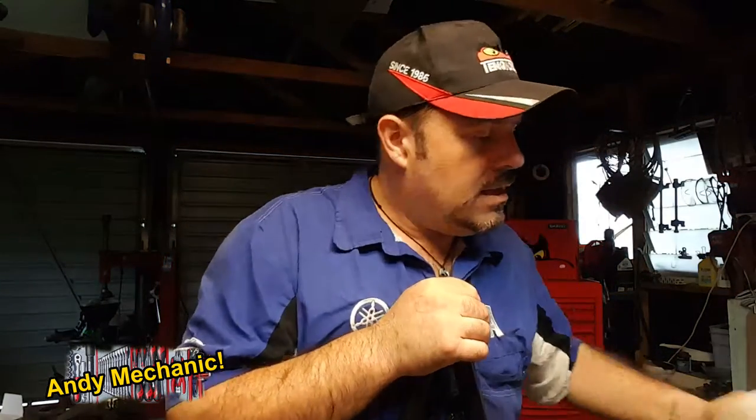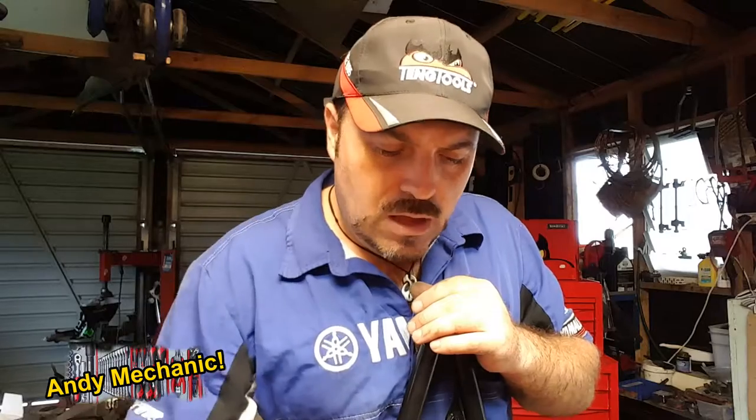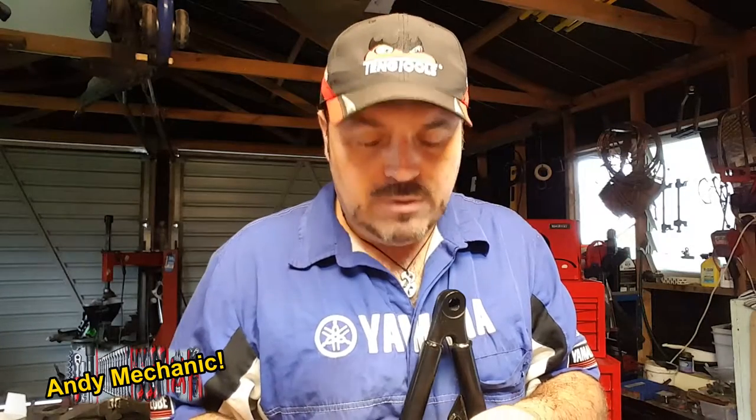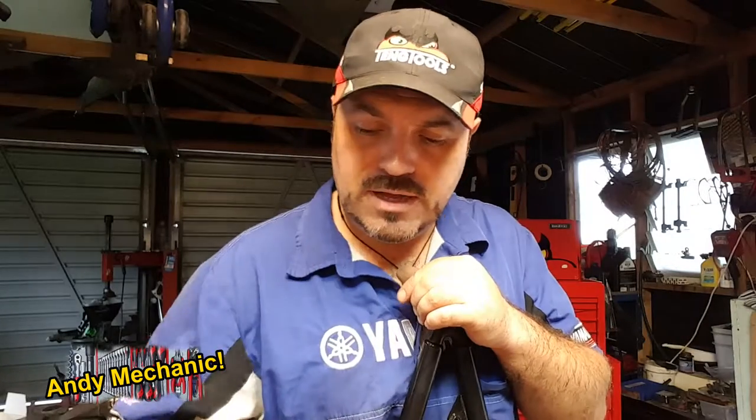And in the previous video, we removed the knuckle joint, the hub and the brake disc. We removed both the upper and the lower arms. We also inspected the steering system on the left-hand side of the vehicle, and we found that the outer ball joint, the track rod end, is faulty, so that's already a fail. That's going to need to be replaced. The inner joint tested out just fine.